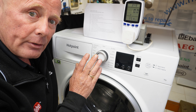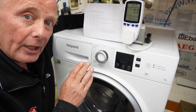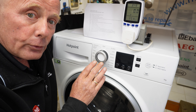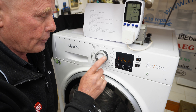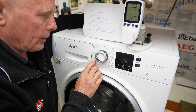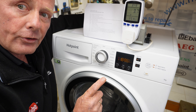That's the easiest way for everyone to understand how to enter test mode. First, machine off, turn the dial to the mixed wash position. You may have to do this a couple of times — if you don't do it in the allocated period of time or make a mistake, it will time out. So: 12 o'clock position, turn the power on. As soon as it comes on, turn it to 1, turn it off. Turn it back to 12, turn it on. Turn it to the 2 o'clock position, turn it off. Turn it back to 12 o'clock, turn it on. Turn to the 11 o'clock position, press the start button immediately.